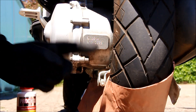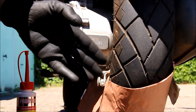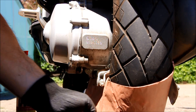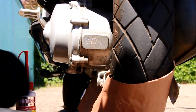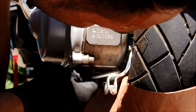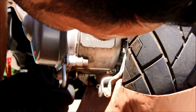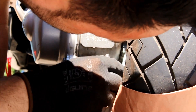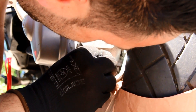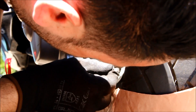Before we start, I protect the tire because when we open the drain screw we need to protect the tire from the oil, otherwise you get trouble. First, use the hexagon screwdriver to loosen the drain screw for the gear — it can be removed very easily.